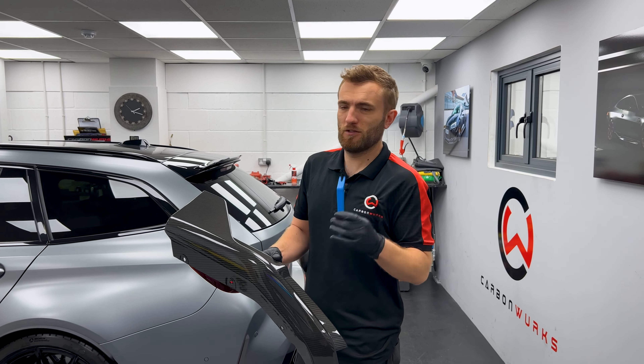After the clips, much like the side skirts, it's purely a case of clips that hold it into the rear of the bumper. So if you can get your hands under it and pull away — as you can see, a reasonable amount of force is needed, but that's all it is — just a case of pulling on it.